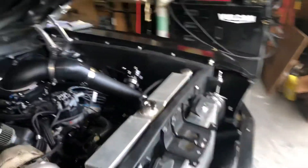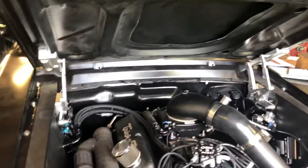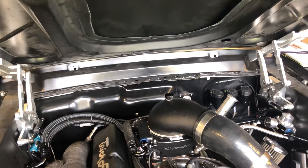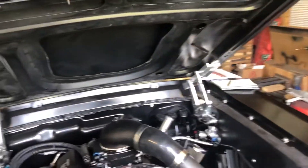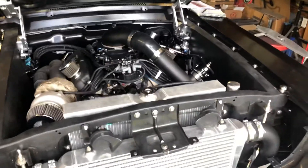Phase your rotors. Get your grounds right. Run all your cables nicely. Don't use crazy vampire clips, butt splices, and all kinds of crap like that — get good wiring. It's EFI, not a carburetor. You're not just sending 12 volts to a fan anymore. Also, don't tie your EFI wiring into anything that generates a lot of noise — that'd be electric fans, alternator, starter, big motor stuff. Holley literally tells you that in their instructions. Use relays if you need to, to get clean power off the battery and trigger it off of something instead of splicing into a noisy circuit.